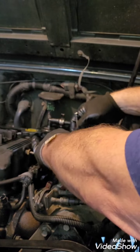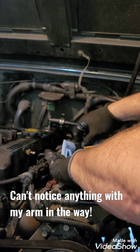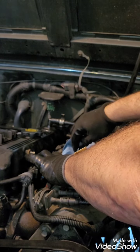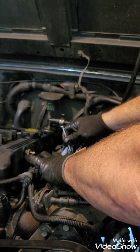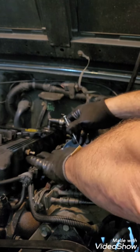And this is going to spray. So I just put a rag over it and then touch. And if you notice, the gas went right in there. There is now no pressure on my fuel line. It's like a tire valve. All right, so there's no pressure on it.